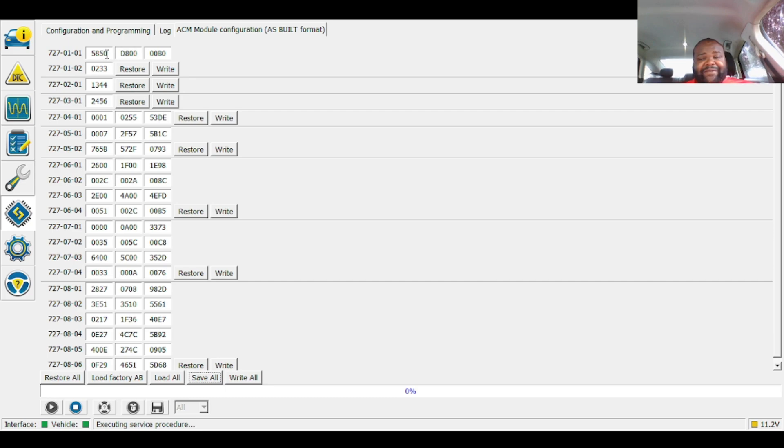You can change that to a 9 if you want to put the pins in for a dedicated subwoofer out, and of course the center channel if you want to add a center channel to the vehicle. The D — I'm going to switch that back to F because I do have the antenna on top of the roof. F basically means don't check for the speaker outputs as far as the open loop.